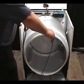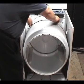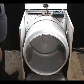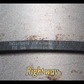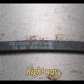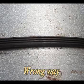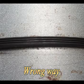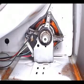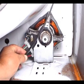Place the belt around the drum. Make sure you place the belt around the drum with the flat surface to the outside. If you have it the other way, then you have it the wrong way. Make sure that the ridges or grooves on the belt are facing the drum.